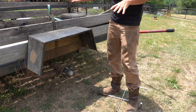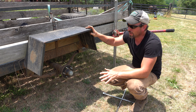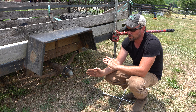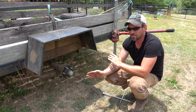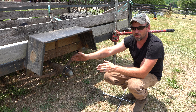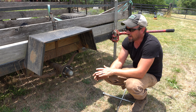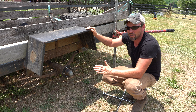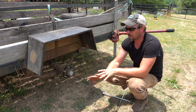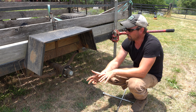It's really important that when you're jacking these up, you distribute the weight pretty evenly so that the trailer stays stable. I showed a quick video where I put a jack stand on one side and the trailer still shifted and rolled because the other side was still unstable. What I did this last time was put a jack stand on either side of the front end, jacked it up from the back side, and made sure the other wheel had something keeping it from turning. Trailers are very unstable when you're jacking them up — they're not super heavy, but if this thing fell on me it would still hurt.